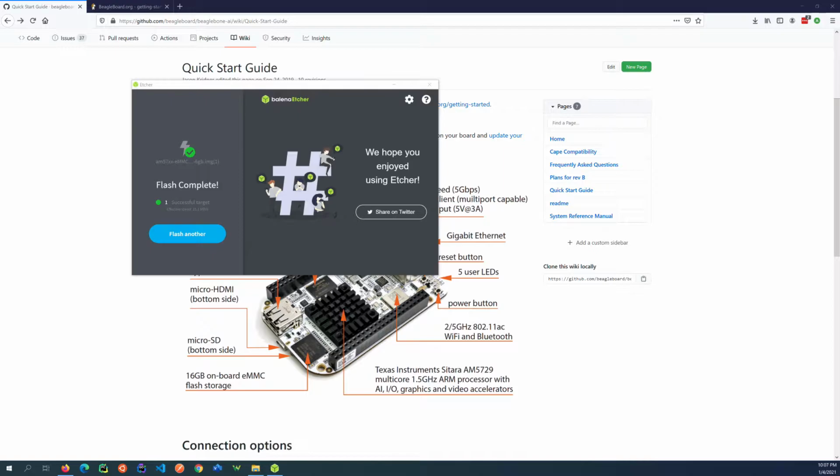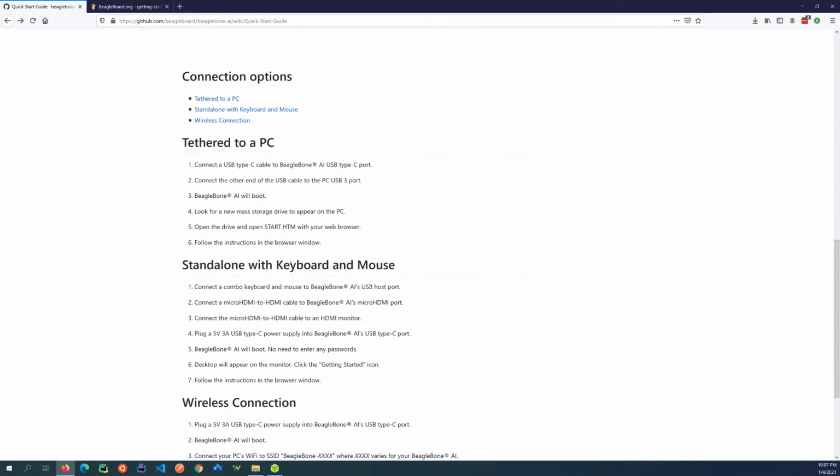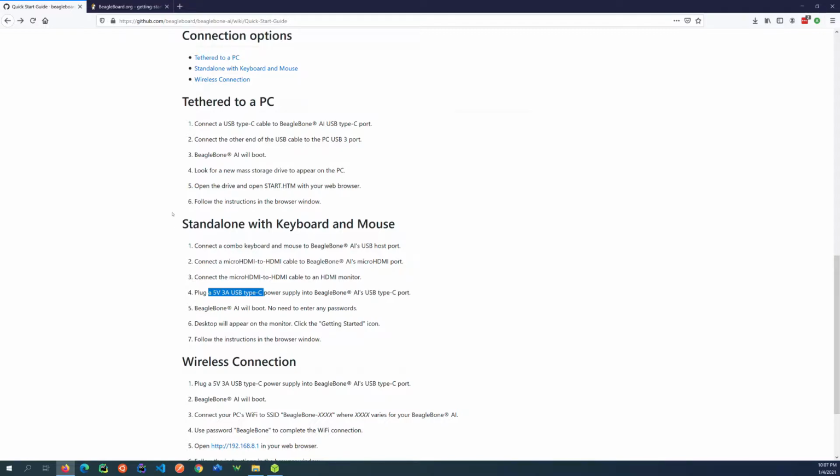I don't know if I mentioned this earlier, but when I did this the first time, I'd read on the stats here that it takes 5 volts at 3 amps, I believe, is what they were looking for from these connectors. So it's 15 watts. I had this plugged into the USB ports on the top of my desktop, and those are not directly connected to the motherboard, and I don't think those get as much power as the ones on the back. So when I plugged this in initially, it powered on and started, and it was on for a little while, and then it went into a reboot loop, where it would reboot every 2 seconds and it just wouldn't stay on. I think it was being underpowered by those USB ports I had it in.